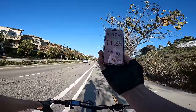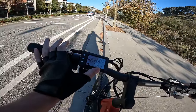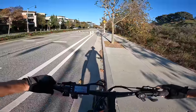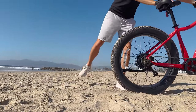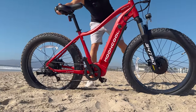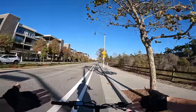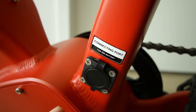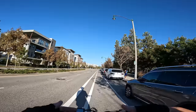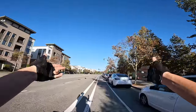Let's go see what the final range is. This crossed over 19 miles, about an hour and 37 minutes out there today. Range is showing 46.7 volts — just under half, which I would agree with; 48 volts is about the halfway point on a 48-volt battery. I was really putting this thing through its paces — hooning, riding in soft-pack sand, which really puts a lot of strain on the motors and the battery. Largely throttle with a little bit of pedaling. Realistic range expectation would be just over 30 miles, maybe 35 miles. This bike also has an easy plug-in adapter if you want to add a second battery to basically double your range — though you'd be adding about 8 to 10 pounds of extra weight. All around, a good bike, a solid performer.